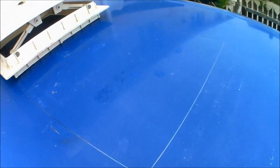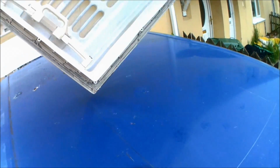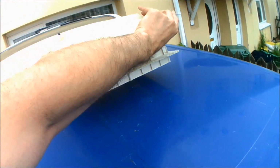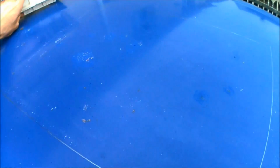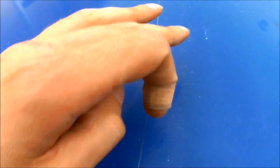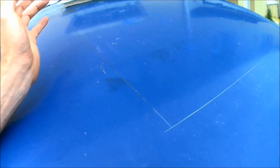I've already marked up the area on the roof. It's a 28cm cut that's going to be required. It's a 30cm skylight. The overlap makes it the 30cm. But marking up wise, you want to be making a 28cm square, making sure it's 28cm all the way around. It's a full true square 28cm. You haven't got it lopsided whilst drawing or anything like that.